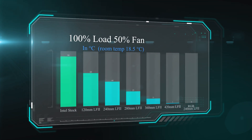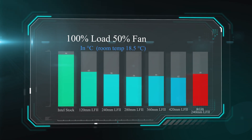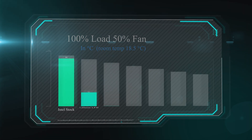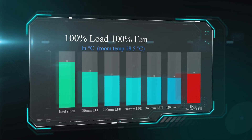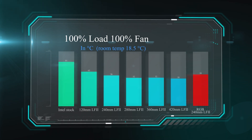In the next test we checked how hot the CPU gets under full load for 30 minutes, collecting the average temperature over that period. With the fan speed also at 50%, the Liquid Freezer 2 RGB version did run a little bit hotter than the standard 240mm version — but we're talking about 1 degree here, so it's not a huge difference. Running the fans at 100% speed, you're looking at roughly a 2 degree difference between the RGB and the non-RGB version.